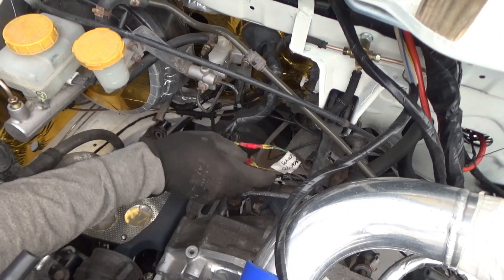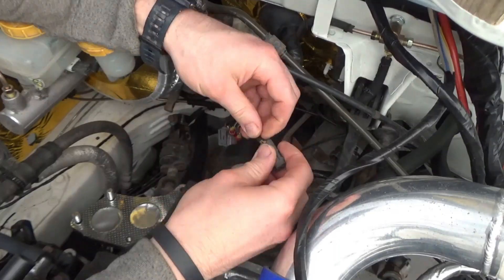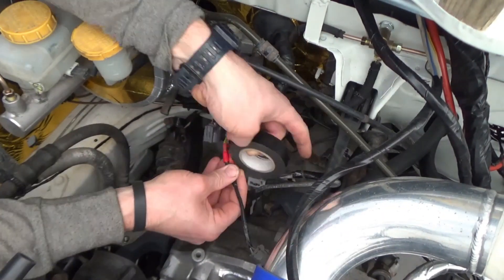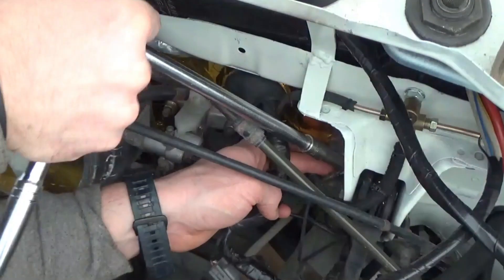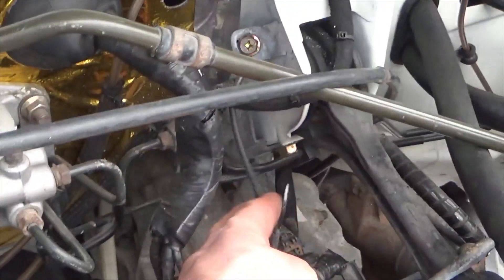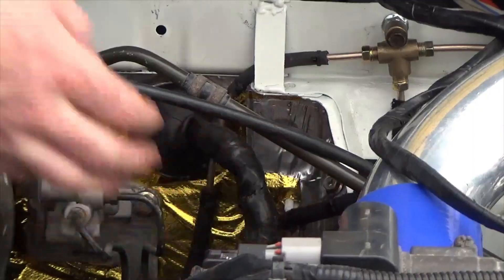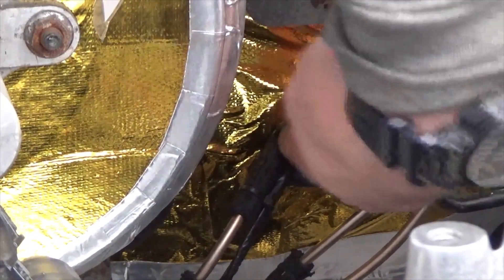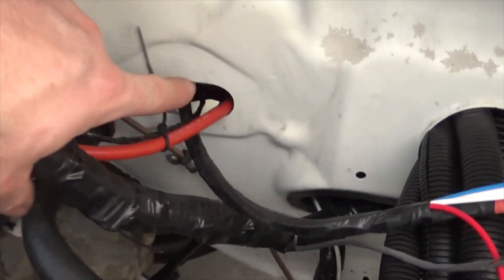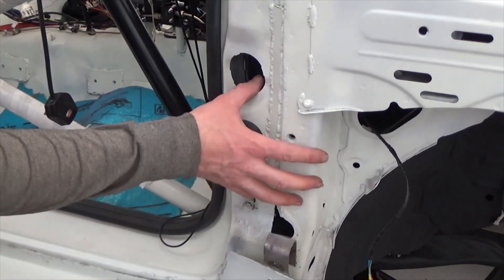Next I will finish off the part of the wiring loom that goes into the plugs on the gearbox, then I want to start sealing the bulkhead — putting the rubber grommets back in where cables are coming through into the engine bay. I've just attached the earth to the gearbox. I'm going to leave the hole where the engine loom comes through because I may need to run some more wires after testing. I'll also leave one hole for the electrical cutoff cable. I have also made a grommet for the power to the starter motor. Next I will seal all of the holes in the A pillar.